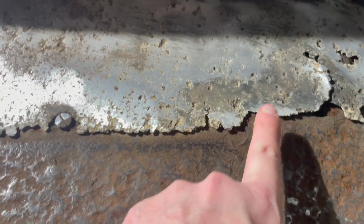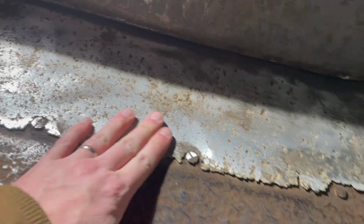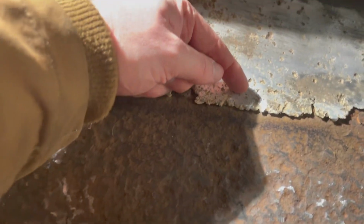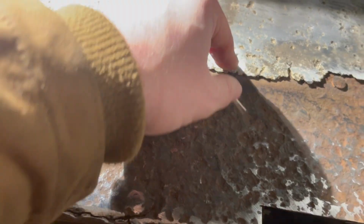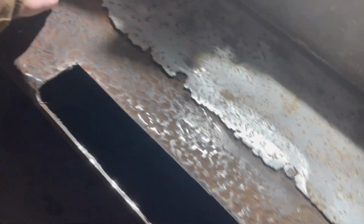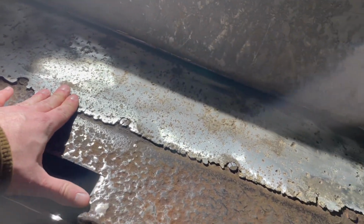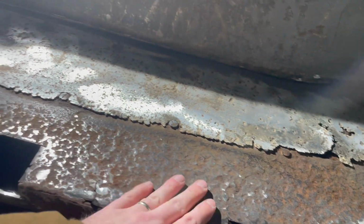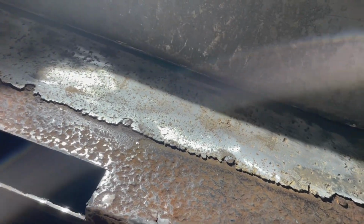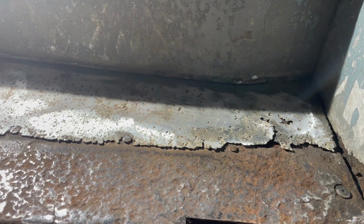These screws, these big flatheads, used to hold down this aluminum panel. Like I said, I'm not replacing this. There is about half an inch of steel underneath this aluminum. So we'll probably do like 1, 2, 3, 4 just small rivets. That, along with some seam sealer, maybe some mar glass on top of these, I'm not sure. We'll seal this whole thing up nicely.